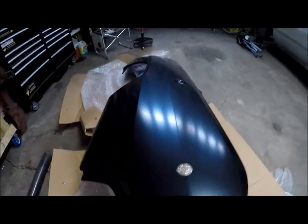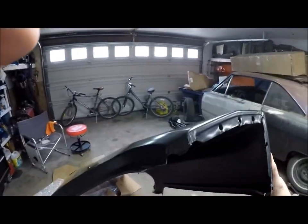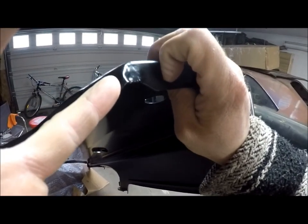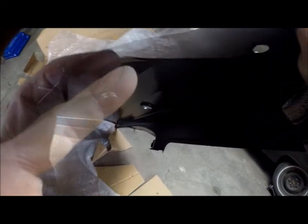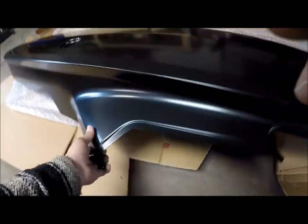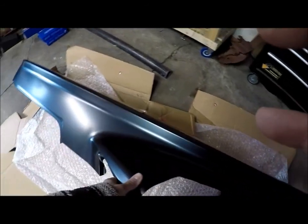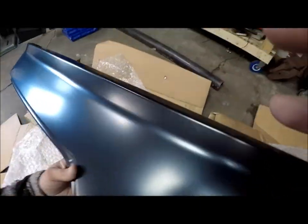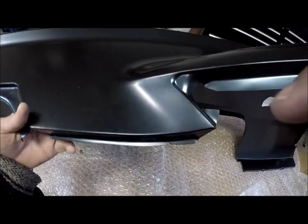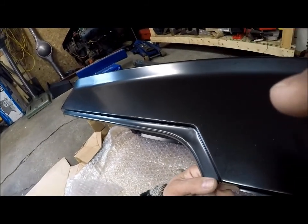Give you guys a look at the whole panel. One thing I was trying to find was where does it all fasten — you know, on the internet. I found that this area here I needed to rework quite a bit to get it to fit the car right. I had trimmed this back about halfway when I did my other side. I also trimmed off this tab because of the awkwardness of placing the panel in and out. Then I had to hammer and dolly this a bit straighter, more 90 degrees, just to tighten up the trunk gap.